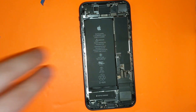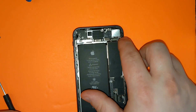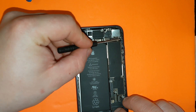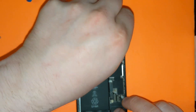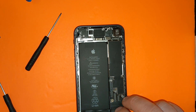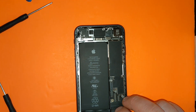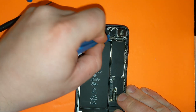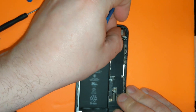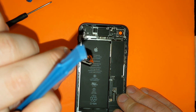And now we have the phone left — we're gonna take some more parts apart. To remove the camera, you will have to unscrew two screws: one right here and one right here. Now I just have to pop it out — that's the clip for it, as you can see. The camera is gonna come off — there's the connector for it. As you can see, the camera just came off.